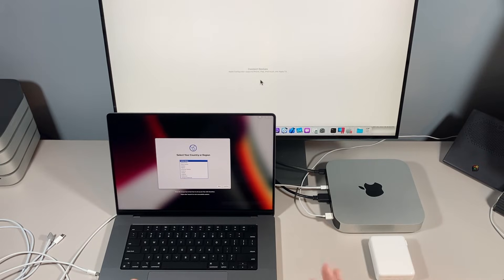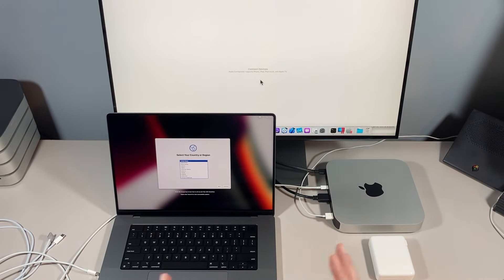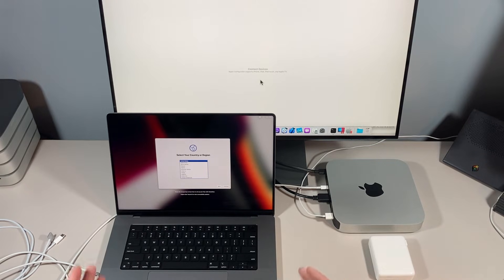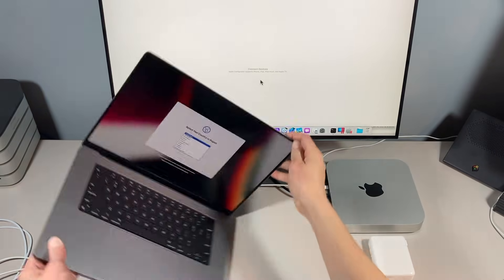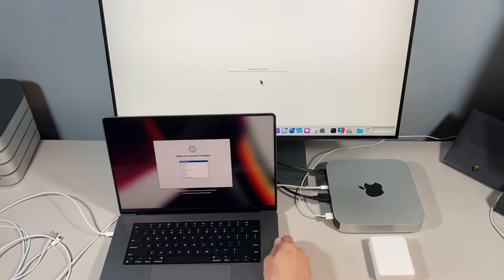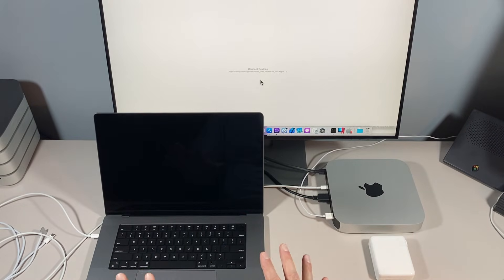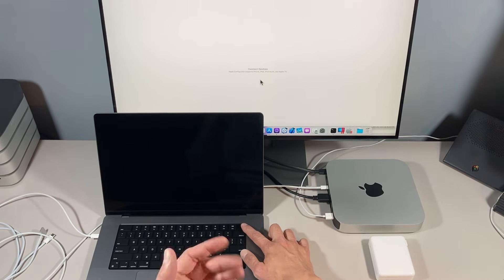Now we've got the 16-inch here. The process for the 16-inch is basically the same as the 14-inch — I wanted to show you live that the same process works for both devices. Since we're plugging in the cable while it's already on, we skip the step of powering down first because plugging in the cable powers the system on anyway. We'll plug in to the port closest to MagSafe or closest to the screen — that's the DFU port for M1 Macs — then turn it around and hold down the power button to power it off. Give it five seconds, and we're ready. We'll hold down all four keys for 10 seconds, then release control, option, and shift, and one second later release power to enter DFU mode.